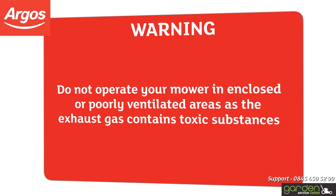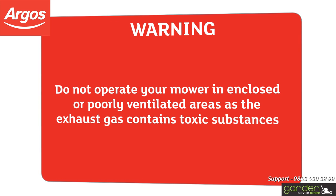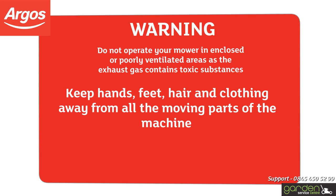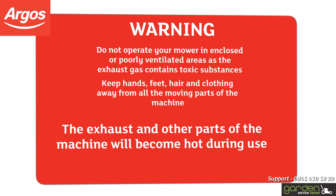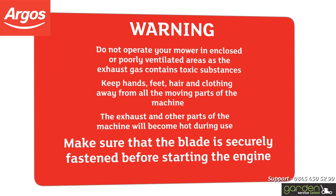Warning: do not operate the machine in an enclosed or poorly ventilated area, as the exhaust gas contains toxic substances. Keep hands, feet, hair, and clothing away from all the moving parts of the machine. The exhaust and other parts of the machine will become hot during use. Make sure that the blade is securely fastened before starting the engine.